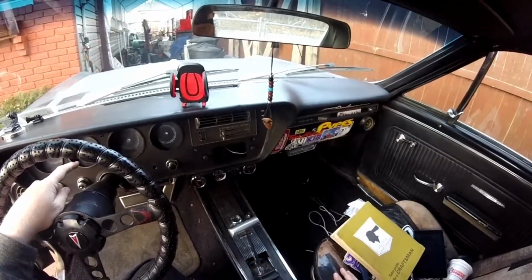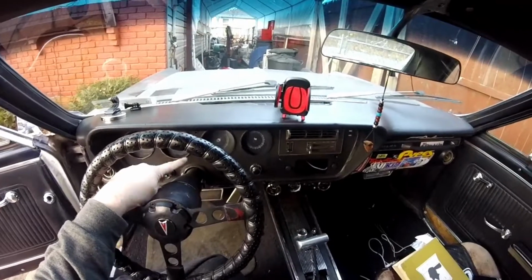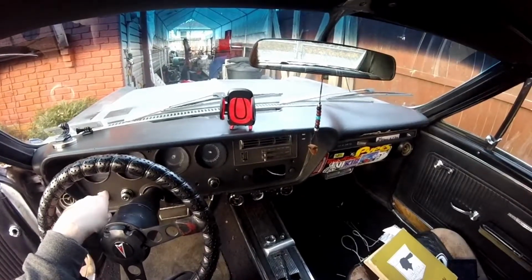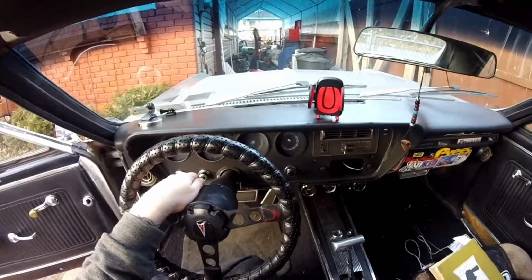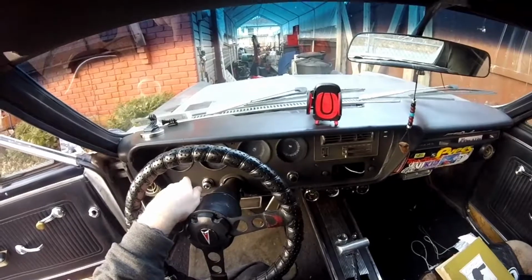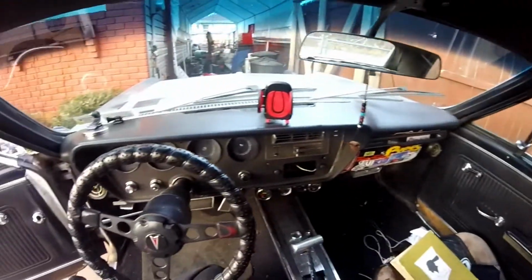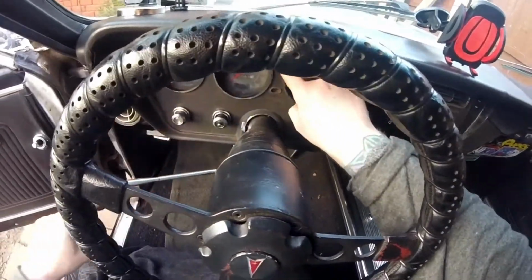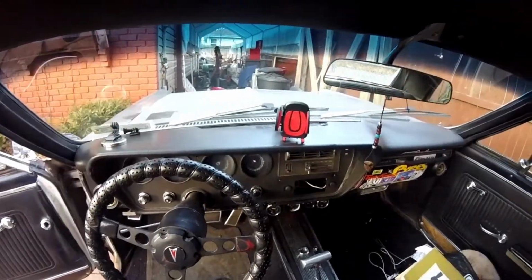Now they're providing the switch 12 volt, so when the ground by the ECU is closed, it completes the circuit and these lights light up individually, one for each fan, which is kind of cool that I know which fan is running and when. It's not particularly useful because if it's not overheating, the fans are probably running, but still, it's a neat little reuse of it. So the new gauges don't have that, so I might reuse that and get a couple more little LED lights like this, poke a little hole in, and that way I can just, you know, maybe up here and here, or maybe reuse the high beam, something like that. And that way I will still have that capability.